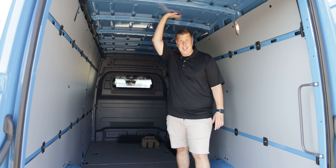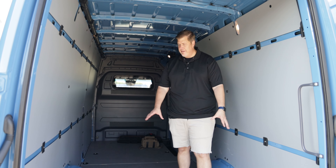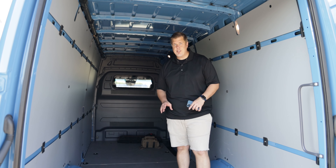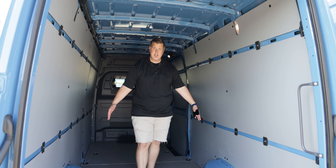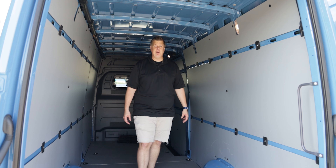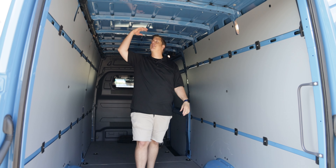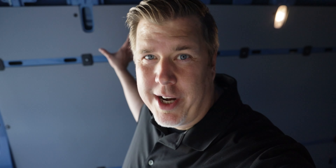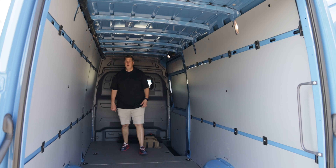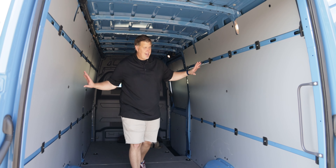The side sliding door has a lower step in than the rear cargo doors. Your standing height is 79 inches — I'm 6'1" and can stand up in here with no issues. The full cargo bed length is 174 inches, the width from wheel well to wheel well is 53 inches, and total width is 70 inches. Full cargo volume is 488 cubic feet, which is a massive amount of space. The cargo area also comes equipped with LED lighting, making it great for tools, equipment, or a van life build.